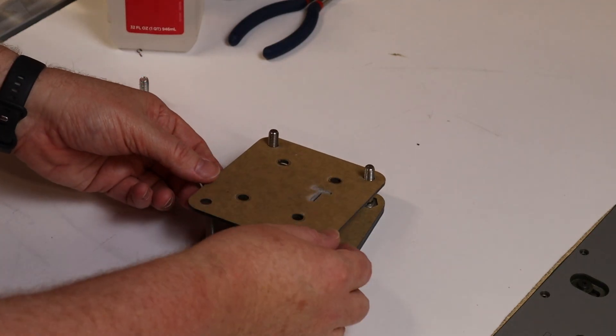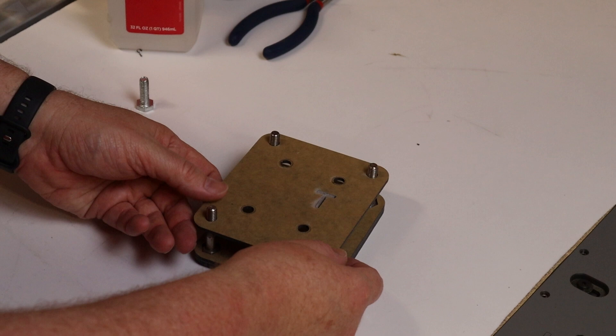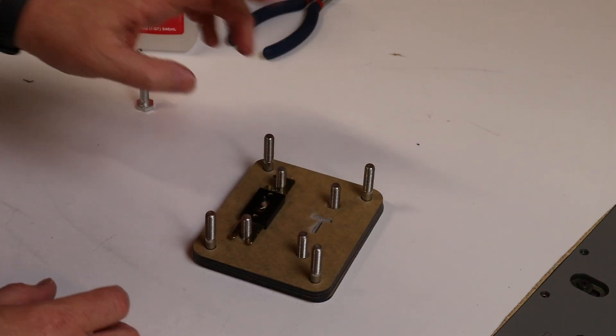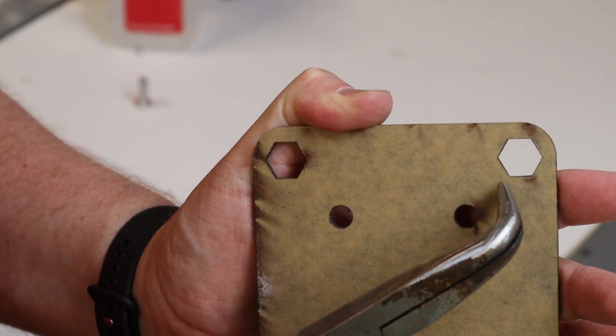You have to keep in mind that the studs attached to the fuses are going to be hot, so you've got to cover the bottom of those bolts. You've got to have a way to bolt the bolt down, so to make that easier, this fuse holder has a hexagon shape cut into the base to secure that bolt.